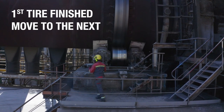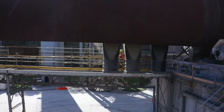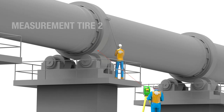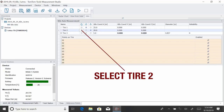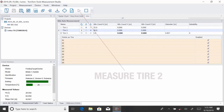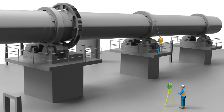Move to the next pier — here, tire number two. All the tires will be measured the same way. Try to cover the circumference as much as possible. In the software, select tire two to be measured. When the assistant is ready, push the start button. Repeat the sequence until sufficient points are collected and then move to the next pier.